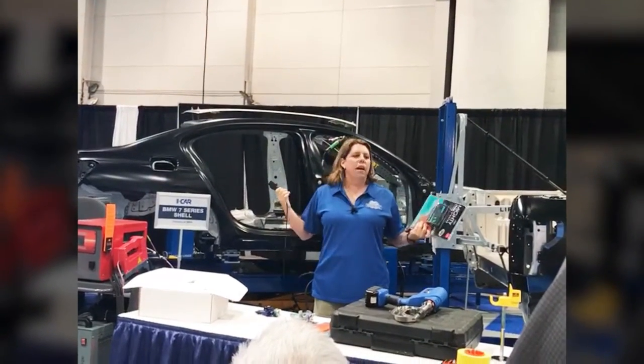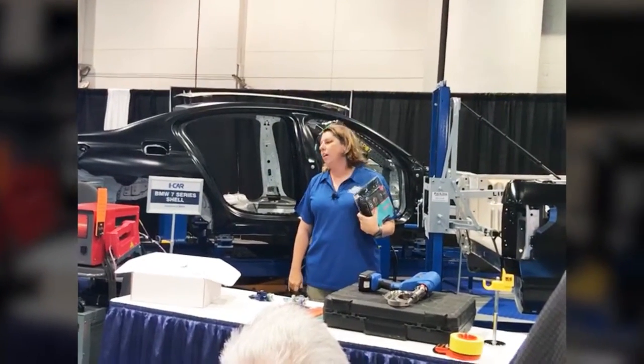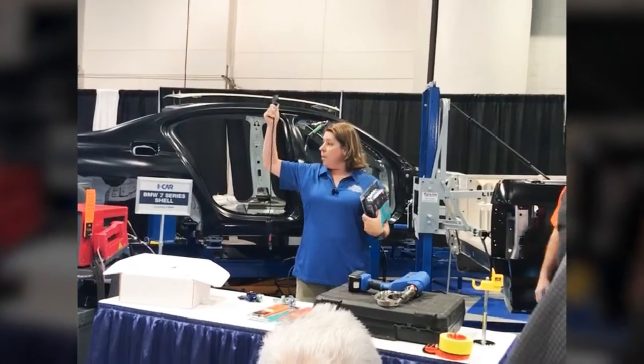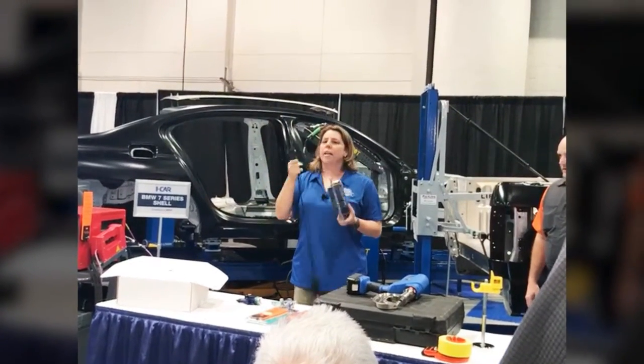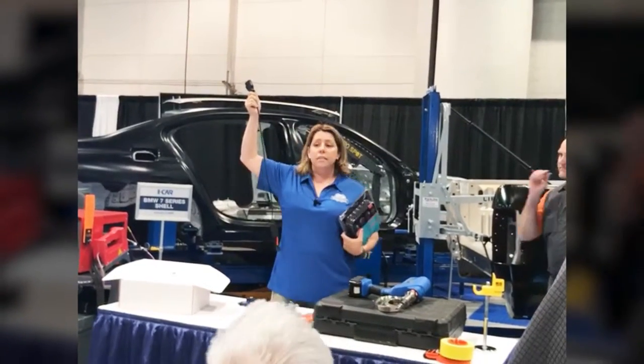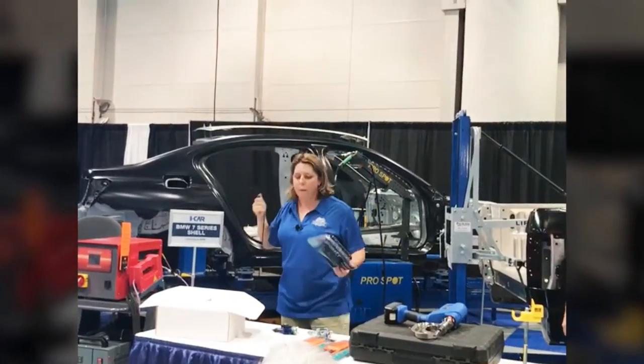On today's cars, how many presets do they seem to have? Radio station, seat position, cell phone memory, all these things that the car has. I can put this to the OBD port. I can plug it in. I can do a setting save. It will save all my presets. I can disconnect the battery. I can repair the car. And when I reconnect the battery, all my presets go back on the car.